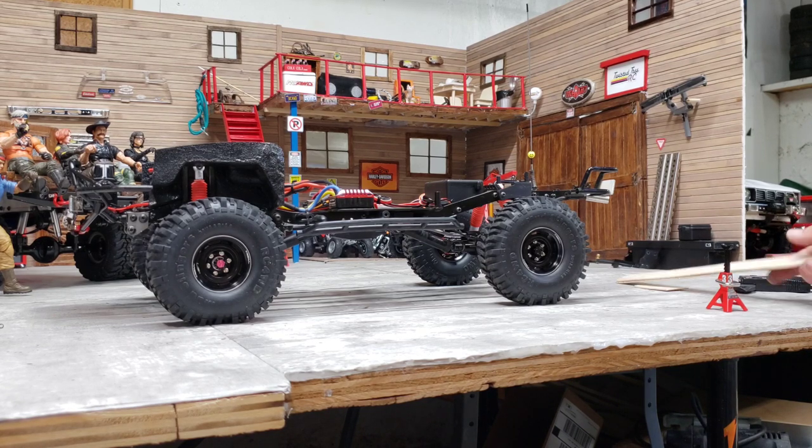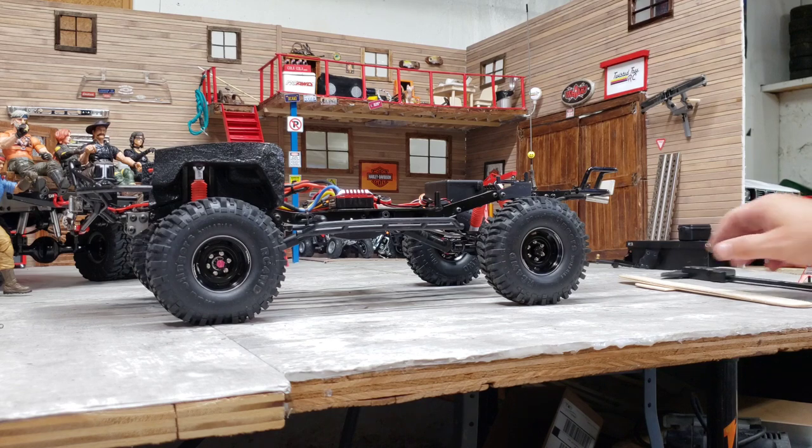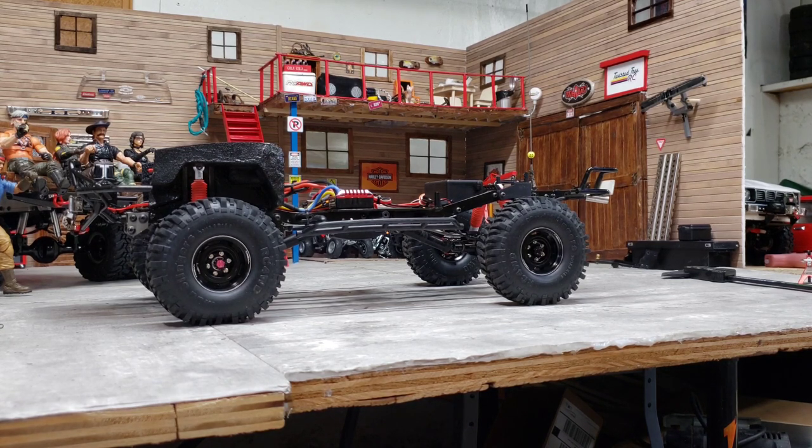So you're going to get right around 3.5 more millimeters of clearance from the Bauhaus skid plate. That puts you at roughly 58.8 plus 3.5 — so about 62 millimeters total. That's almost a 4-millimeter clearance upgrade, which is well worth the cost of the skid plate in my opinion, especially if you're running rock or creek stuff.